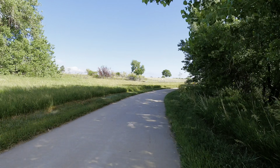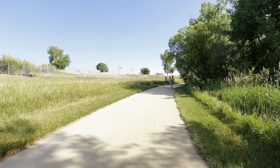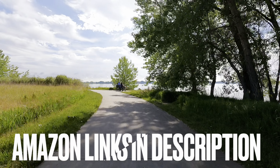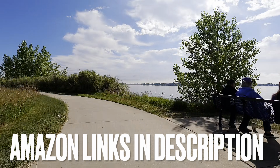At first 400 watts seemed a little underpowered because I'm used to 500, 700, 750 watts. Now a lot of them are up to 1,000 watts standard, but the 400 watts on this thing goes. Like I said, it does 22 miles an hour, and I think 22 miles an hour is the higher threshold for the size of the tires, but it does it all day. It has throttle and it's a good hub motor, built pretty well.